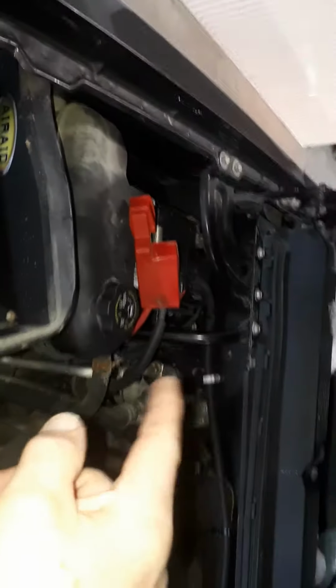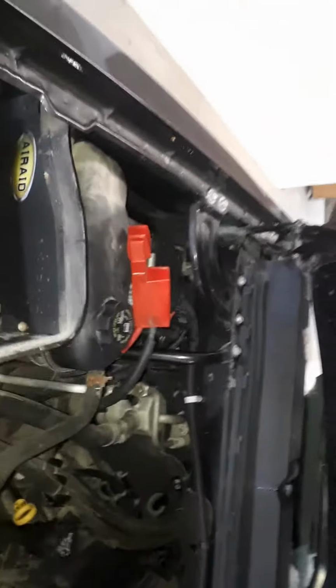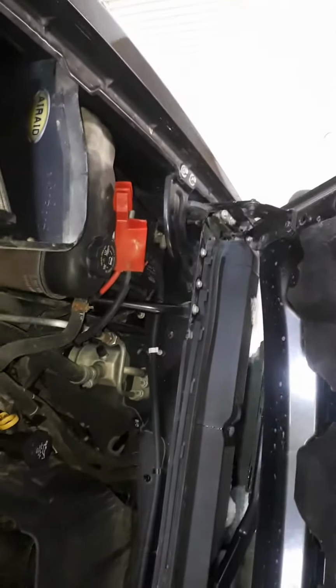Okay, motor running well. Your alternator is charging, but your battery is not holding a charge. So your battery is pooched. That's what I'm gonna say. You've got an aftermarket air breather. Motor, I can't hear any, there's no mechanical issues that I can hear. Your fluids are up, she's clean.